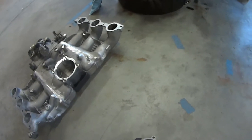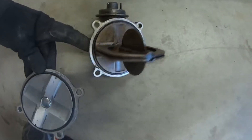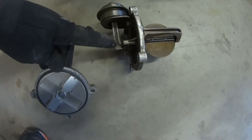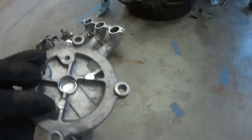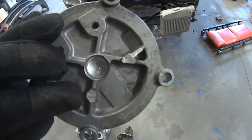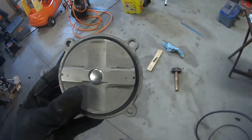Anyway, what I have now from my other engine is essentially that same piece that I've modified. What I did is I took my hacksaw and cut this part off right here, and just disassembled the iris valve actuator there and took it all apart. That left me with a hole in the middle here. I looked at threading it and putting a bolt in, but eventually I settled on putting in a freeze plug. I drilled it out a little farther, got the exact size freeze plug, and then with the hammer I gently tapped it in there.